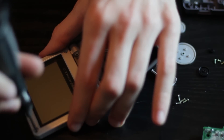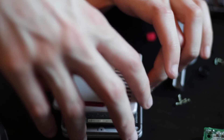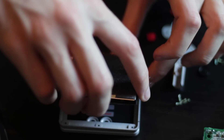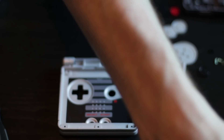Now what you're going to want to do is unscrew the screws around the screen, which will allow you to take apart the molding around the screen. With all the screws removed you can take off the top of the SP and get at the screen. Now is a good time if you want to replace the glass over the LCD screen — you can peel it off. It takes a little bit of work, but it comes off fairly easily with a little bit of prying.